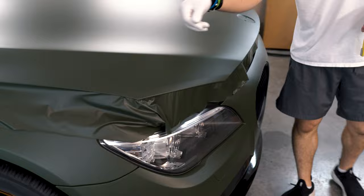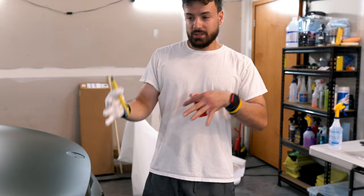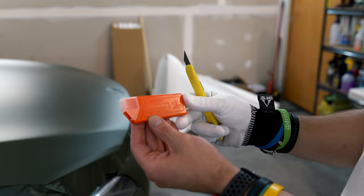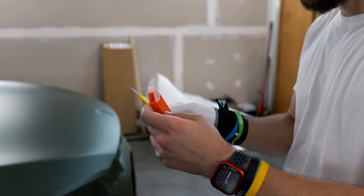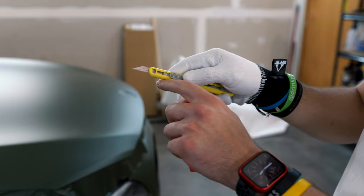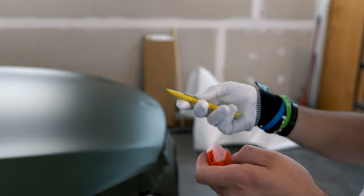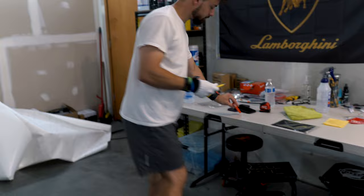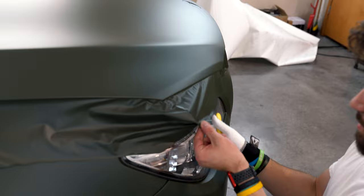Now I'll show you how we cut the corners and where we trim. Take your wrap blade. I've used this blade a couple of times so I'm going to crack it. This is how you crack a 30-degree blade — you use a blade dispenser slash breaker made by NT Cutter, which is also where I get the blades from — find it on Amazon, just search NT Cutter blade bank or blade dispenser. You can see the blades have perforations — that's where you crack. Put it in the dispenser up until it covers that black line and that's how you crack your blade.